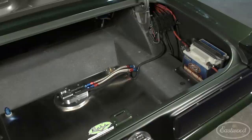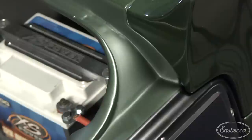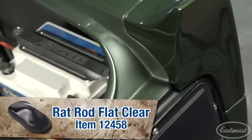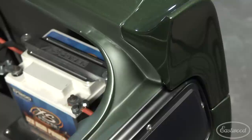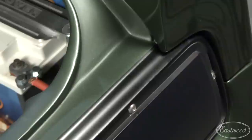Take a closer look at the two-tone lines in the paint. If you look closely, it looks like two different green colors, but it's exactly the same base color sprayed at exactly the same time. I just used the Eastwood flat clear on the trunk jam, and the taillight housing has the gloss clear — the euro clear — on it. It changes the refraction and the depth of color you can see. That back masked off with the Boulevard Black on the taillight panel gives a really cool, classy custom effect with very little effort involved.